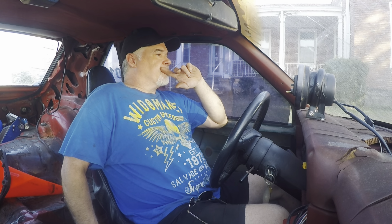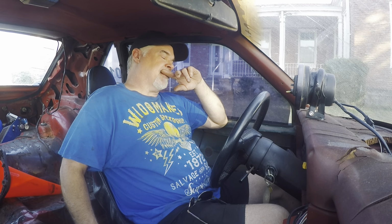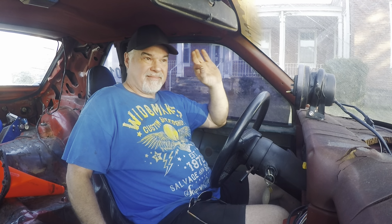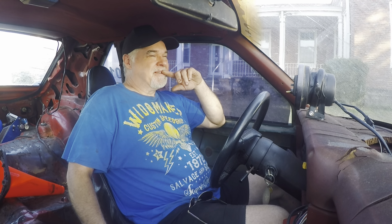So you guys tell me, and listen, whenever you're making these guesses, I'm not trying to tell you how to do it, but you know, weather is a huge consideration in how a car performs, how an engine performs. Cool, dry, dense air, if you can get it, that's the stuff. Hot air is not as good, especially when it's got a bunch of moisture in it. Now, it's not humid, but it is going to be substantially hotter, I think, than the last time we were up there. So, take that into account. Heat, also sun on the track makes it kind of greasy, so there's a few factors there that play into it.